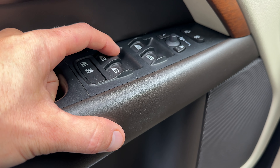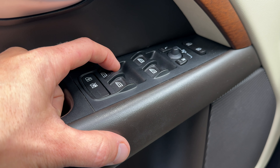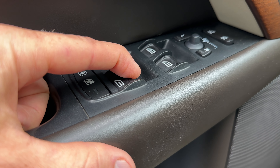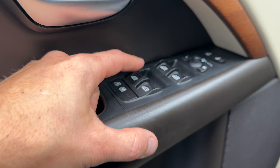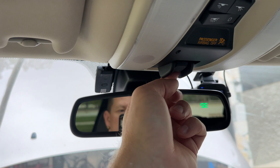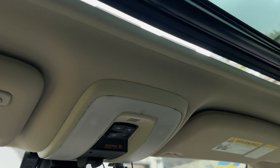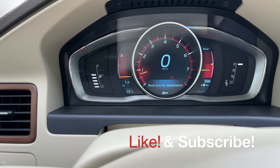Roll it up, and once it's fully up, click into the second position, wait two seconds — and it's reset. Repeat for all the other doors. The sunroof is not affected, so it will still operate as it should — auto open and auto close — no need to do anything with the sunroof. The windows are now initialized. I hope you liked this video. Don't forget to subscribe to the channel and hit the notification bell so you don't miss any other videos. Thank you for watching, and I'll see you next time — bye bye!